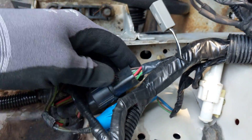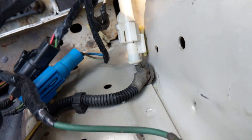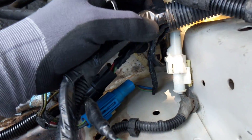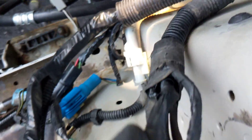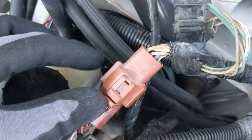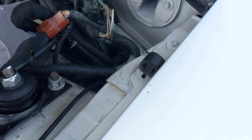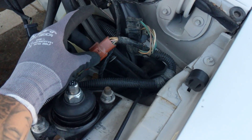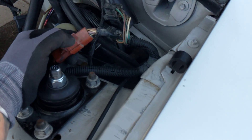It ends here. When you unplug these, that goes to the four cylinder harness. This right here is part of the four cylinder harness — everything that hooks up to the solenoid is part of the four cylinder harness; you're going to keep that. It goes into the firewall on the driver's side — keep that. This is a one plug. This is the V8 harness now, four cylinder portion on the body. If you have a 91 harness you're going to have a black plug and a white plug — same thing. You'll be able to use the body harness and the dash harness from the four cylinder.